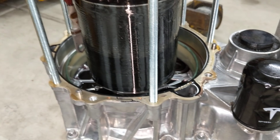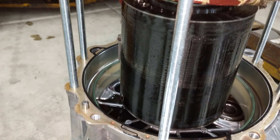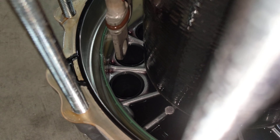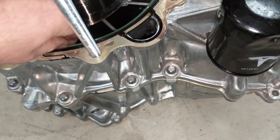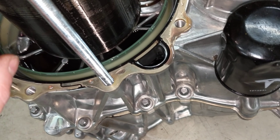There's a stack of wave washers there for preloading that bearing, and my tube is sitting on top of that with the encoder underneath — specifically the magnet that forms the rotor of the encoder. The encoder tells the inverter the motor's position to a fine degree, which is really needed in a variable traction application. Down in the housing there are three black plastic tubes with O-rings that seal this cavity so oil won't get into the inverter side. There's also a windage ring with holes that allow oil to be sprayed directly onto the motor windings.